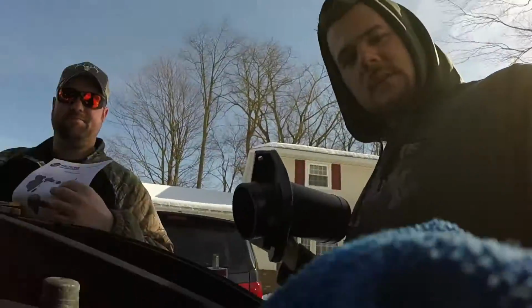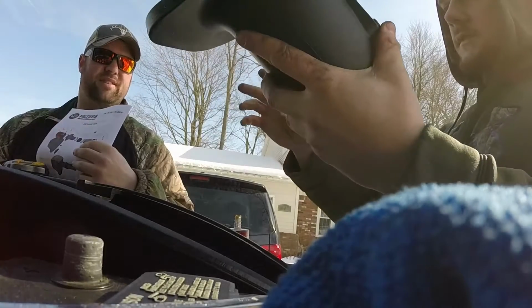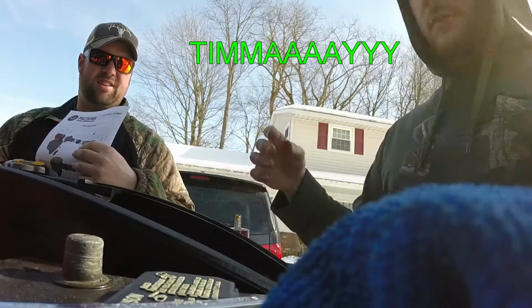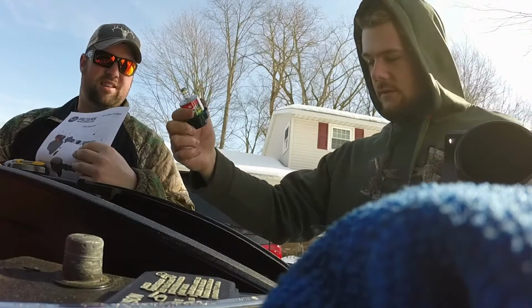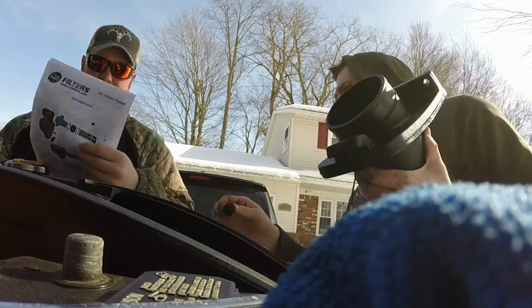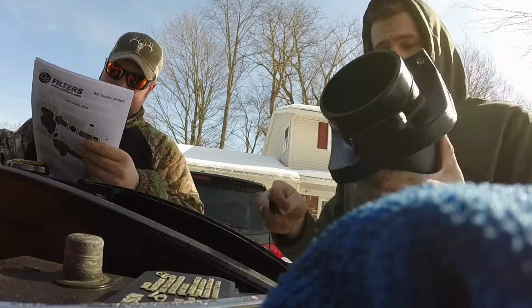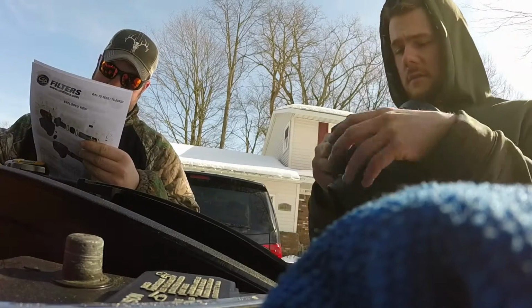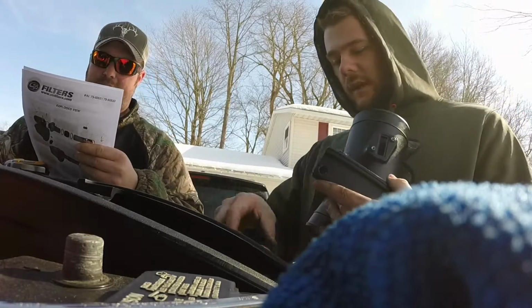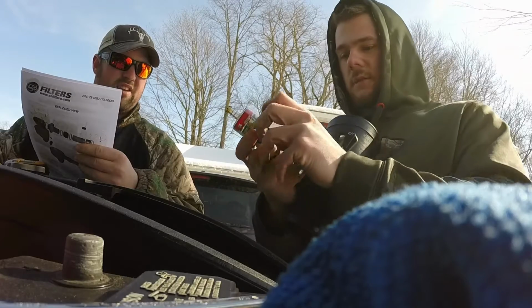So now that we got everything else in, you gotta grab this off your actual intake filter. You're gonna need to reuse the restriction gauge. They call it something different. What do they call it on there? The filter minder. But it's really a restriction gauge, or Donaldson gauge is what they're really called. You need the filter minder itself. So we're gonna push to reset it.